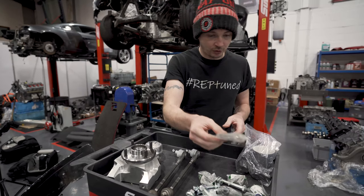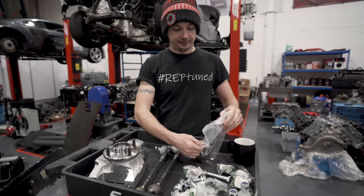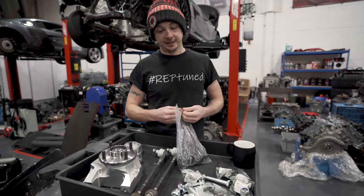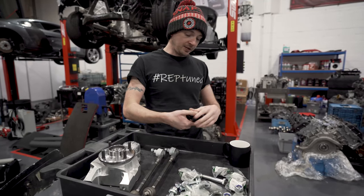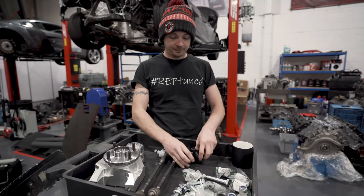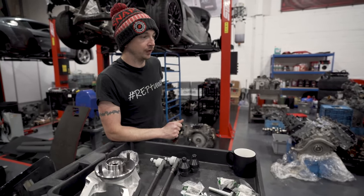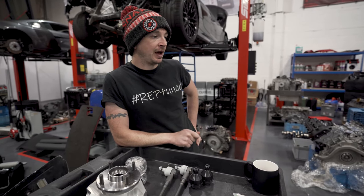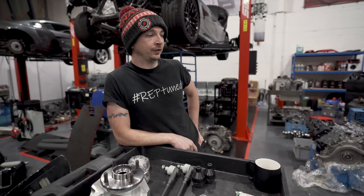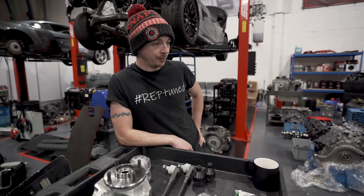Those are the collars that go with that. You mentioned the brakes as well — he's going to need new discs. I don't know what I'm going to do with the discs yet. I'm definitely going to send the calipers to Johnny and get him to rebuild them. I'll definitely put a new set of pads in, and I'll have a look at how much meat we've got left on the disc.